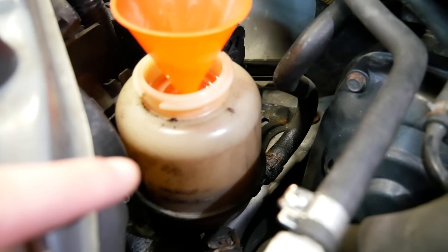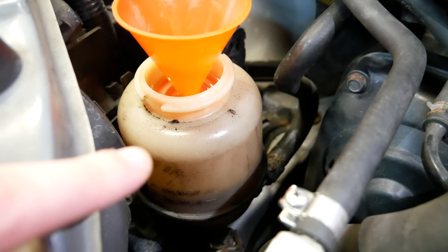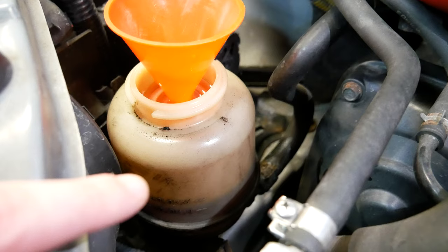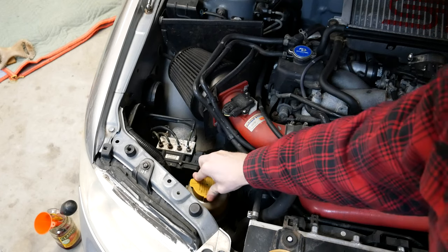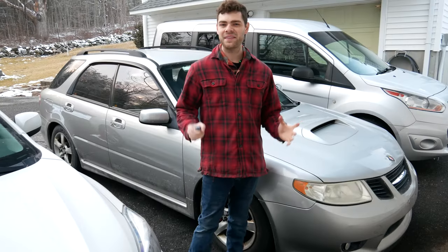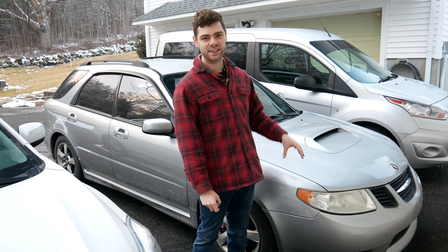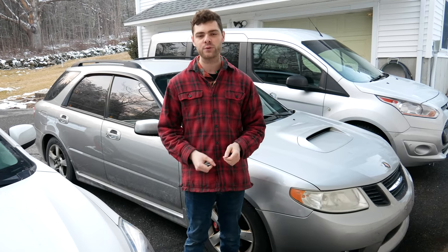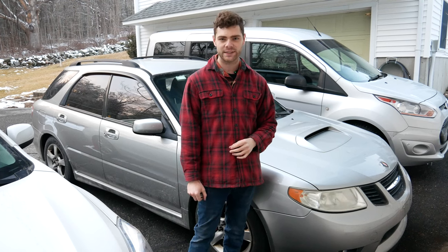The way I made sure I added the exact amount of TransTune I wanted was: I checked my fluid and it started at the max, then I removed 4 ounces, then filled the reservoir back up to the max with TransTune. Now I'll cap the reservoir back up and get the intake ducting back in place. The next thing to do is cycle that new cleaner through the system — start your car and turn the wheel back and forth a few times to cycle the fluid all the way through.